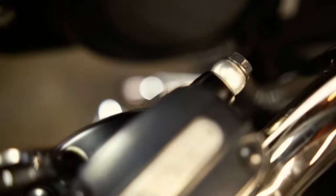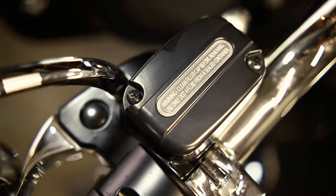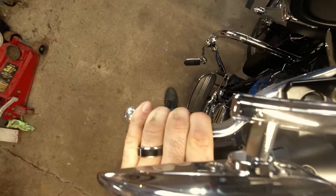In 2017, when Harley-Davidson decided to go to a hydraulic clutch, a big problem occurred. In order to get the clutch to engage, you almost had to release the lever all the way. This made it nearly impossible to find the friction zone.